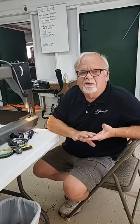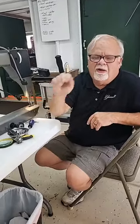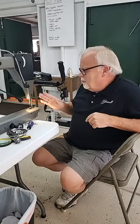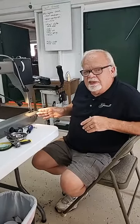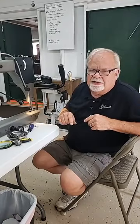Okay, what direction then is the skip? A lot of times it's when they're moving the machine away from them or going towards the pickup roller. What that is doing is pulling that needle away from that hook, along with the fact that your top thread tension is tighter than it needs to be, so that we don't get the nice loop that it should make, and the hook point goes right past it.